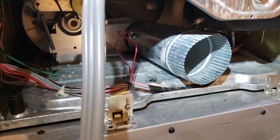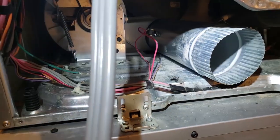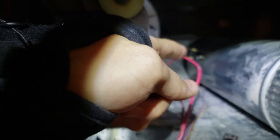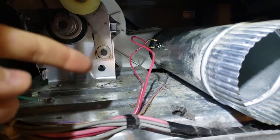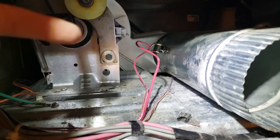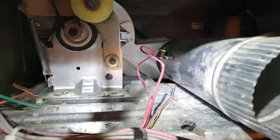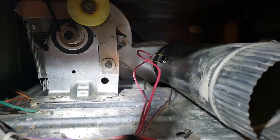I finally got the new thermal limiter switch fully installed, so you can see what that normally looks like. Now, without pulling any of this stuff out, you can actually just bridge the leads — I did it with a screwdriver. Just make sure you don't bottom it out, just short it, and then you can actually test it. I got the dryer to run just by shoving a screwdriver between those, or you can take them apart and tape them together while it's unplugged. Just be really careful — most of the time just leave the dryer unplugged. Just be safe.